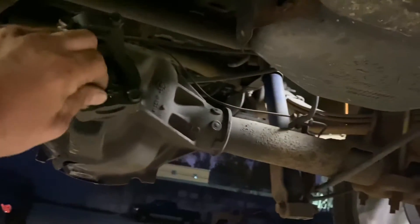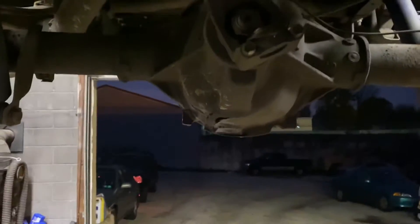Couldn't get a tow truck and needed to get back to the shop. What we did was just took a ratchet strap over and around the driveshaft, up to the top. It's loose, but it got us home — drove it about four miles like this. Wouldn't recommend going too far because you'll heat it up and burn it out, but we were in four-wheel drive and drove it in.